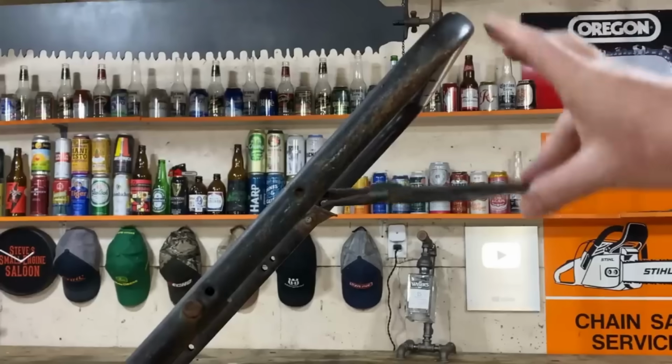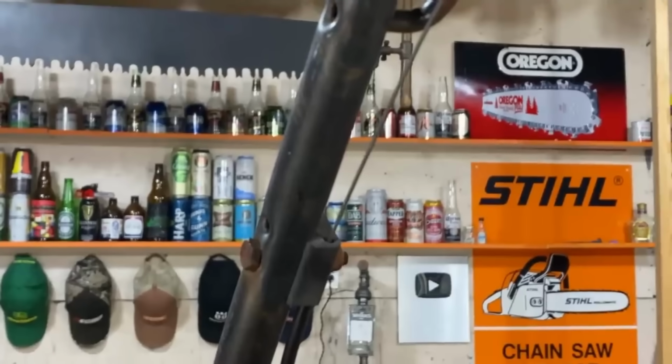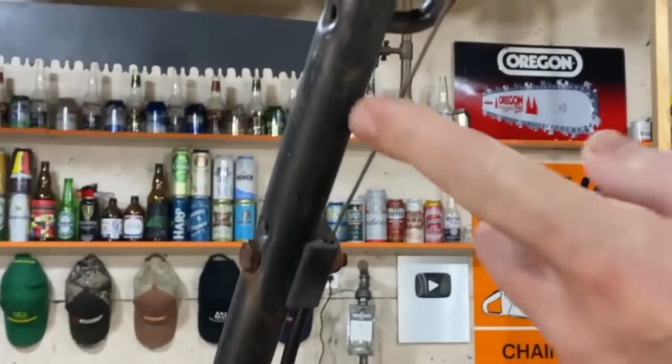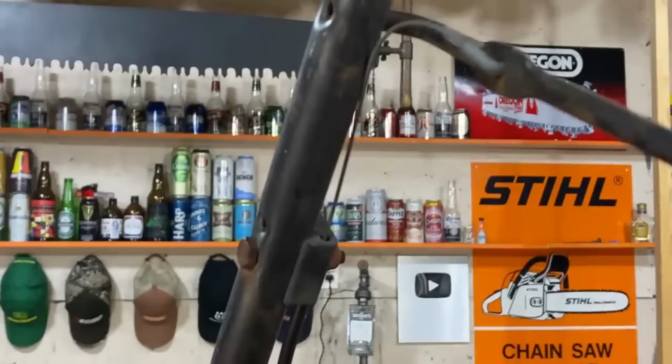The next one is the brake cable, where you pull the bail down to pull the brake cable, that actuates your micro switch at the bottom, which is your on-off switch, and your flywheel brake. You're turning the flywheel brake off and the switch on. Sometimes letting them sit over the winter, especially if you're not in a garage, some people will put them under a tarp outside where it's moist, and that cable can get rusted up. And then the next year, you go to pull that brake handle down, and the cable is rusted and jammed, and it's not pulling your on-off switch off and on anymore. It's stuck.